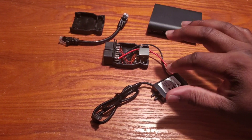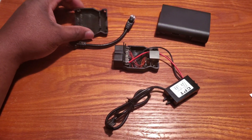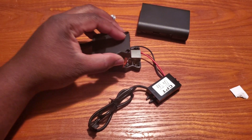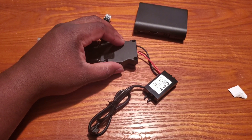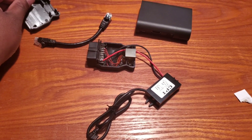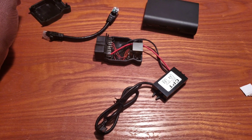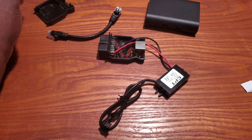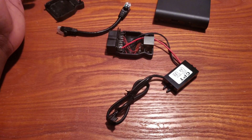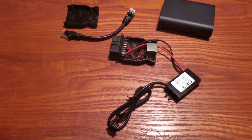What you really need to do is build your ENET cable. The first thing you need is this OBD adapter — it's an OBD to Ethernet plug with four screws so it can be covered up. If you undo the screws, you can open it up and see the wires inside. This one on Amazon is listed to work specifically for F-Series, so just look up OBD to Ethernet F-Series and it'll come up.